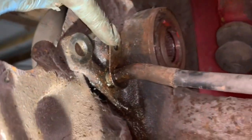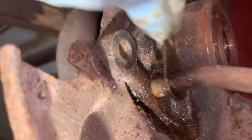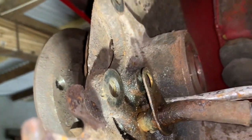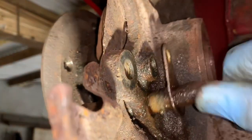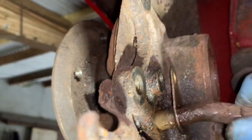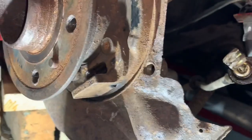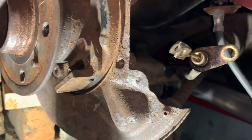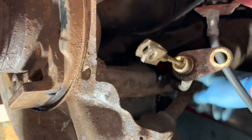This fitting is attached to this pipe and bolted onto the back of the hub. Yours may be rusted solid — just get a screwdriver and pry it loose with a little WD-40 and it eventually comes out. That just pushes straight into there. Once we've got that cable free, we should be able to take the whole control arm off — but I've just realized it's not quite as simple as that, so we're going to have to figure out how to get past these fittings.